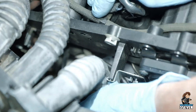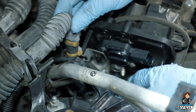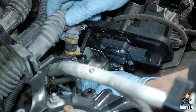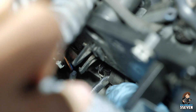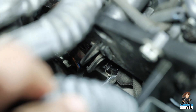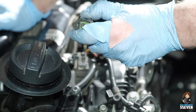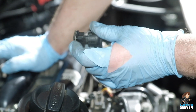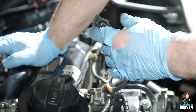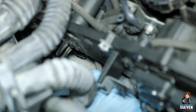This thing hasn't been taken apart at all. These are the harness connection side, and this is the actual sensor side, so we're going to move the sensor side. Two more connections: one goes to the electric switchover valve for compressor bypass, and another one goes to the DPF differential pressure sensor. We're going to do the compressor bypass first. The connection is the same as here - you just press on the spring and release. It's facing the firewall, and the connector spring is facing the passenger side. So you press and disconnect like that.